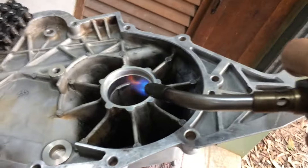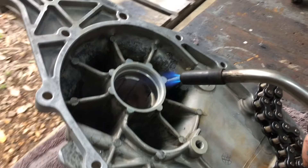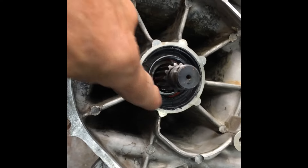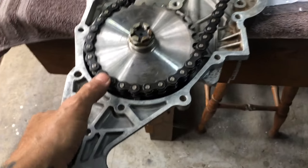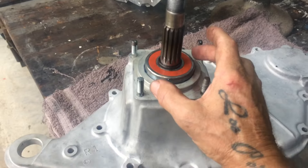That heats it just enough and you can just drop the thing in. The bearing might need a bit of a tap but if you heat it up it definitely helps. I've got to put this down - it drops straight in because I heated it up. The seal goes on the opposite way to what you'd think because it's got to stop oil going that way. There's also an o-ring for each side - the sprocket just dropped on, a lot easier than the other side. Flip that over and do the other side - drive that bearing into that housing.